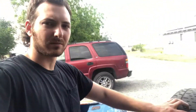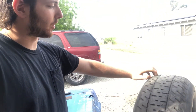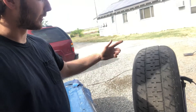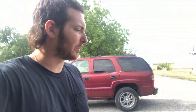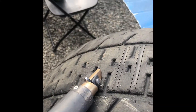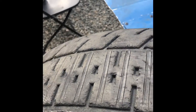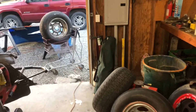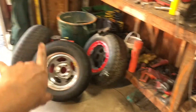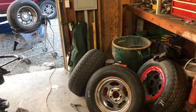I'm siping the middle side to side, and then on the edges I'm going all the way around the circumference. I don't know if that's the best way or not, but I'm going to try it out and see. I got all the tires siped and ground. I didn't groove any, so I just siped, grinded, and flipped. All done — now I'm moving over here.